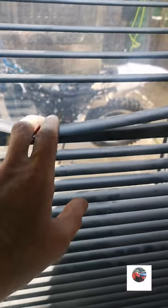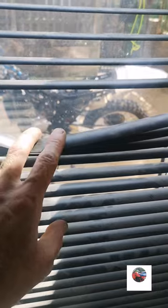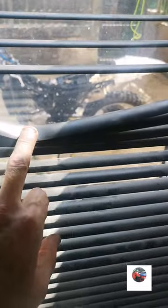This is the final part of the video. I've done the choke, I've put it back on, I want to put the tank on. I can't talk much in the yard because the neighbours give us funny looks. Put the tank on, see if the mixture's there, see if the air screw needs set. But I've had it started, it sounds alright. Like it was 5:10 last night in the house, I couldn't do much.